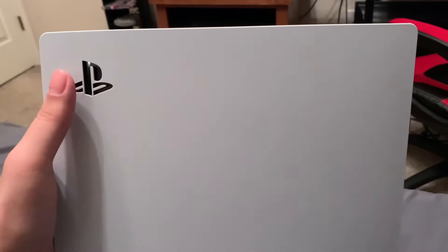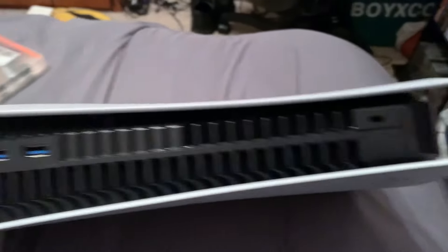For the PlayStation, make sure you have the PlayStation logo face down, and the power button away from you. So this would be your point of view. Then basically grip the bottom right area, and with your left hand grip the top left area, and gently slide it.